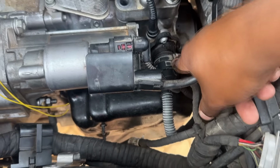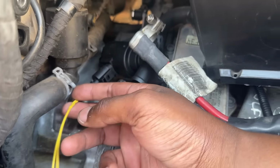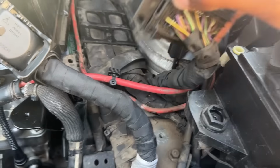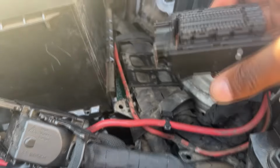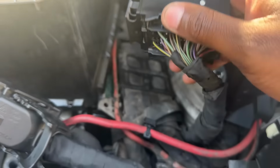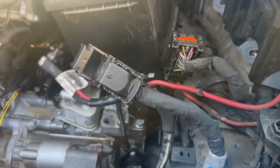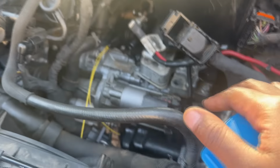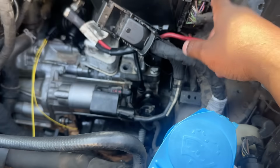Okay, so the gearbox plug has been done and plugged into the car. We have communication, so the next thing we need to do is to wire this thing up. Run the wiring all the way from here to the ECU. This is the body side of the ECU, not the engine side. This one is for the engine, and this one is for the body side, the T91 pin. So on pin number 39, that's where we need to pin it up, so that this thing can now talk to the car. Basically we need to run the wiring from here all the way to there, and once we're done, we just code it all up. The guy to code the gearbox is on his way as well, and then we take it from there. So let me quickly fix up the wiring, and then I'll catch you shortly.